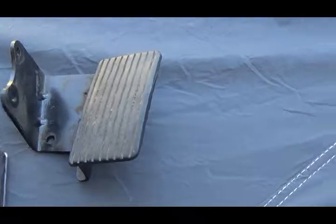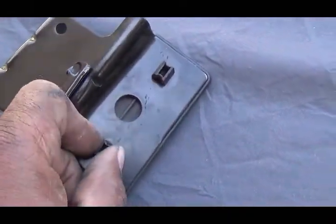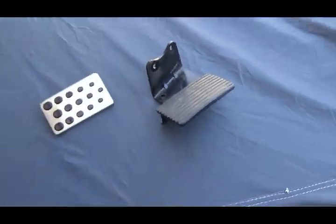go on there, let's see if I can find it. It's somewhere in here. But anyway, you got to take this bracket off, which is right there with 2 bolts. And then I think you're going to have to modify something because of the way it's made, but let me get it out of here and show y'all. So you have to basically take this whole bracket off, and then on the back side you got these clips right here. You got to take them loose, like mash them in, and then that'll pop out. Then you can put the new one in. There's no way of getting underneath this without taking the bracket off to pinch these things. It's kind of hard, so it's best to just take it out, which I showed y'all. I had 2 screws that go right there in the back. So basically, pop them out on the bottom, pop the new piece in, and mount it back. All right, I'll get back with y'all when I get through doing that.